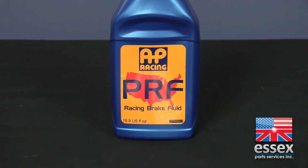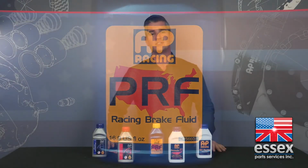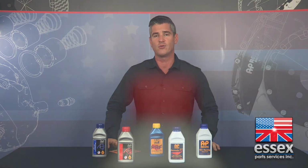PRF, like the R2 fluid, should be replaced only after purging all the old fluid from the system via a manual bleed. Most people find that 3 bottles of fluid are enough to completely replace their existing brake fluid, and you should have enough left over for a bleed at the track to remove any remaining bubbles.